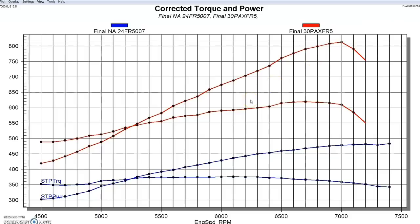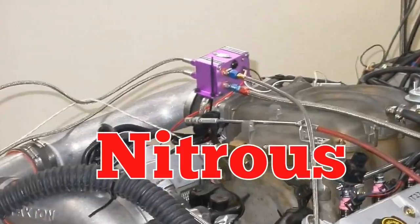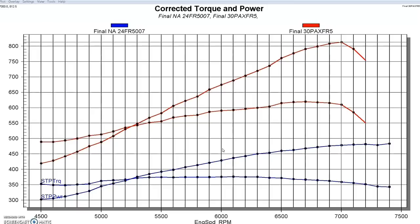I wish I would have had an intercooler and ice water. We couldn't make the power we wanted, didn't have another pulley to increase the boost, and didn't run an intercooler. As a side note, it's really a good idea not to try to run this kind of flow from the supercharger with just a six-rib belt — even an eight-rib belt is a little sketchy. I like to run cog drives on real high-horsepower stuff — four-digit, 1,000 horsepower stuff. A cog belt never slips, so the blower is always there, which I like during testing.